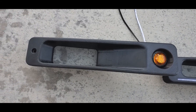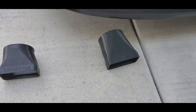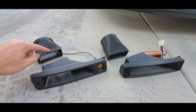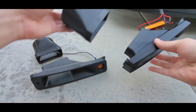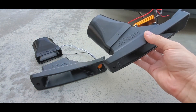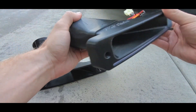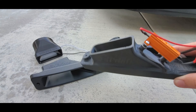In terms of installation it's very easy, but in order to fit a 3-inch or 2.5-inch hose you're going to need an adapter, as shown here. These adapters fit on really nicely. The adapters are intended for 3-inch to 2.5-inch hoses because those hoses cannot fit through the front of your bumper, so they're installed from the backside or underneath your car. There is a top side to this adapter because it has a slight kink to avoid some structure on the car. They're very tightly toleranced — you just snap the duct in. I recommend using some silicone as an extra sealant. This circumference matches a 3-inch inlet, so you're still going to get the same volume of flow through the front of the car.